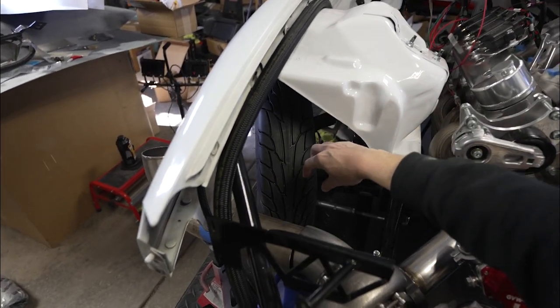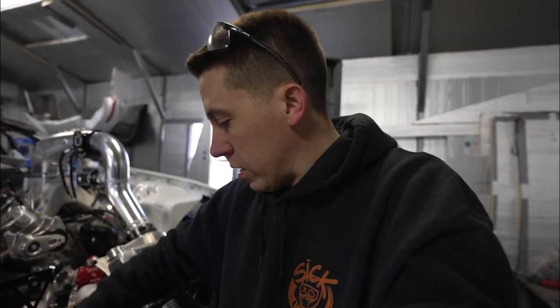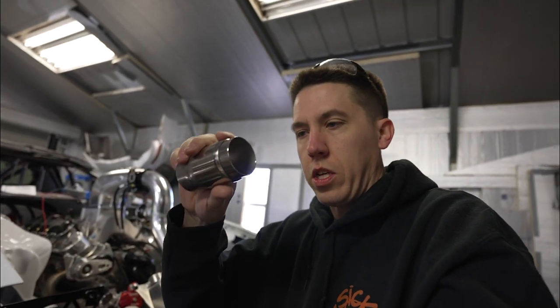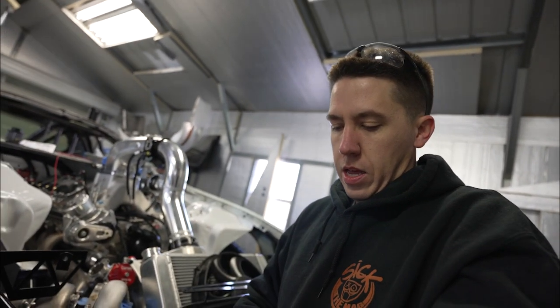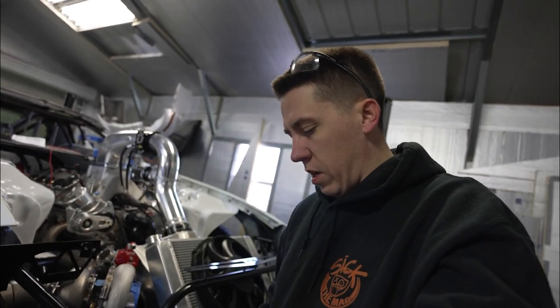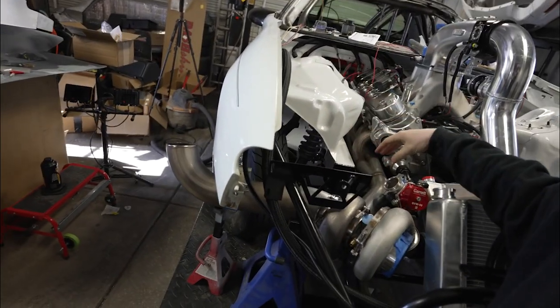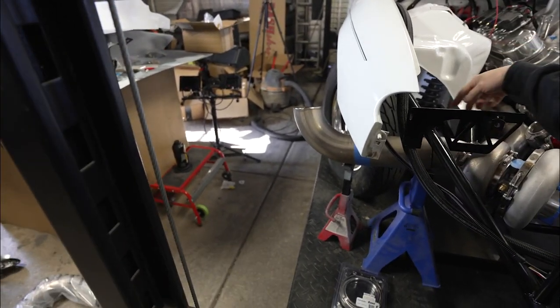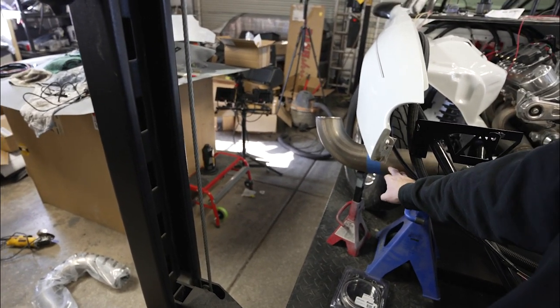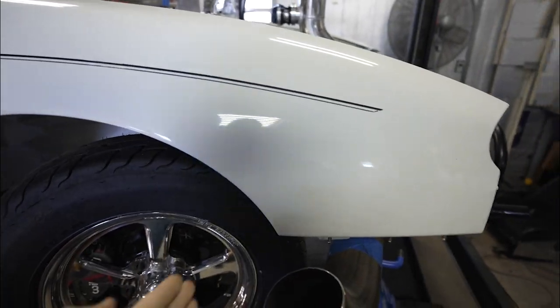I'm thinking the wastegate will come out, cross over, and dump back into the exhaust right here, with the O2 sensor right there. I'd also like that little piece of pipe to be removable, so I ordered some slip connectors — they allow the pipe to slip in and out. First time using these; I figured out how they work and we're going to get them put in the car. I'm going to start by tacking this together, shortening it up, and getting my v-band in there, building out one piece at a time.